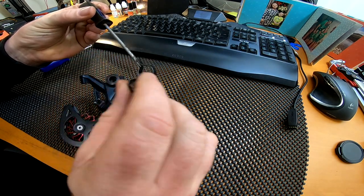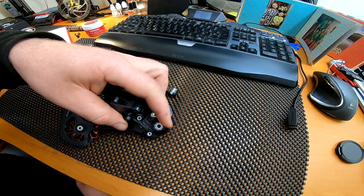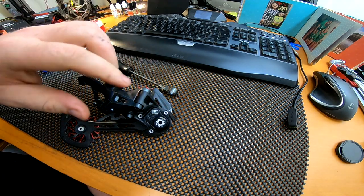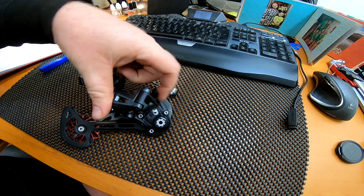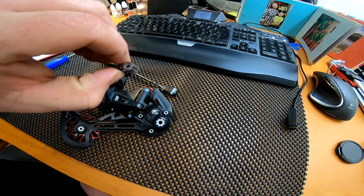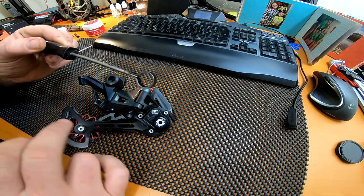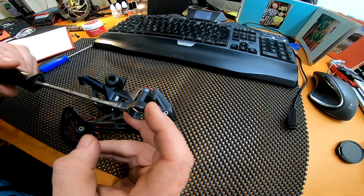In here you've got needle roller bearings in the back — it's a one-way bearing. So as the derailleur goes to pull down and open out, that bearing is trying to stop it with the tension created by the spring. If you put that on, you can quite easily spin it backwards; if you go to spin it forwards it'll stop — and that's effectively what gives you your clutch.